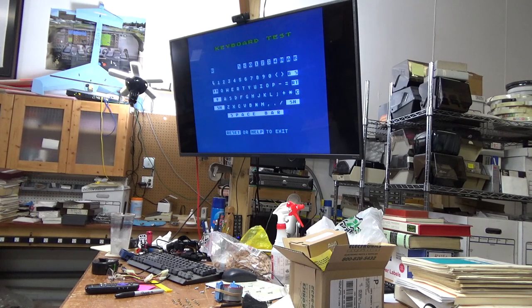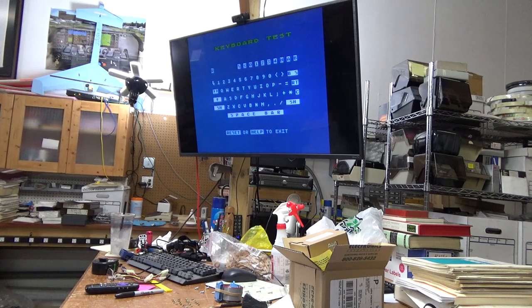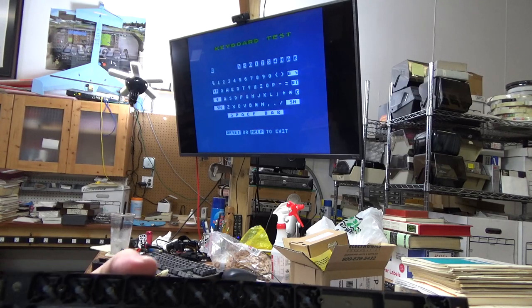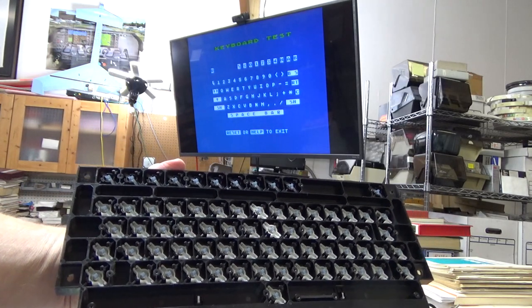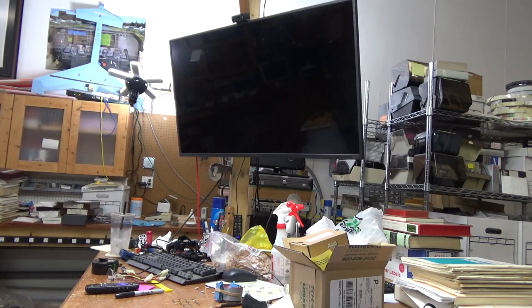It could be because of the membrane, or it could be something wrong with the plungers, although they all look like they're in perfect condition. I'll bring the keyboard around to show you — all those plungers look brand new. I suspect this computer may have tens of hours on it maybe. And I think that just about wraps it up — we'll hit the Reset button, and there we go: a working Atari 1400XL.